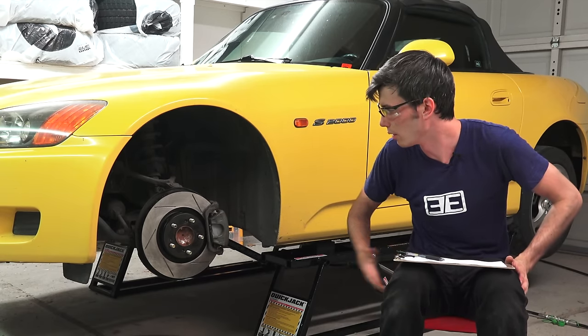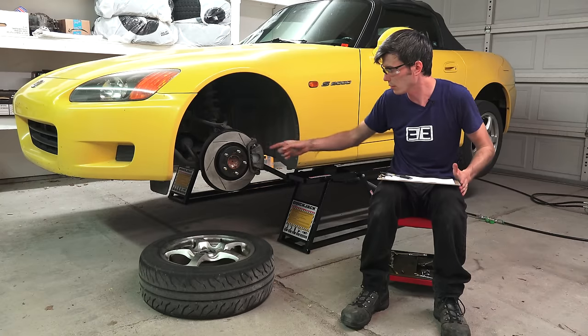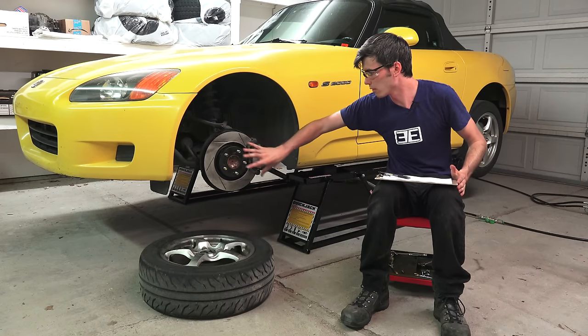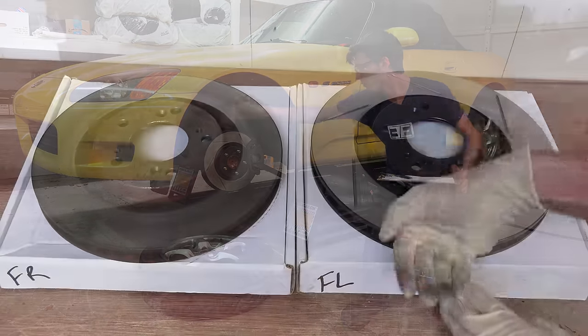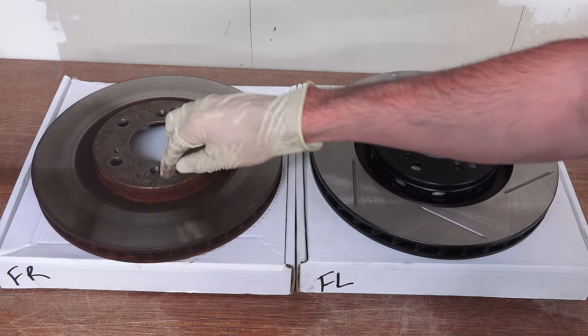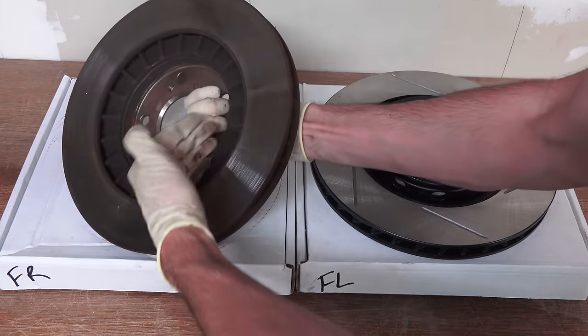It's more expensive because you have to have two castings. If you just have ones with straight vanes you can put them on either side — it's cheaper to make, that's why auto manufacturers use that as the cheapest option. The other difference versus the stock rotors is that this pulls air from the wheel side, from the outside, rather than from the heat shield side where you could have warm air from your engine bay and suspension floating around.